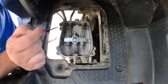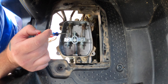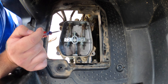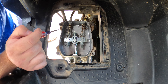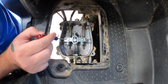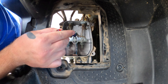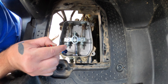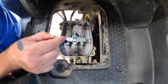That factory setting isn't going to be perfect for every single vehicle. There are all sorts of different options people run — lifts, big tires, different suspension components — which could possibly cause this to be out of alignment even in the perfect factory position. I've seen a lot of people on the forums and on Facebook talk about difficulties getting from turf mode to two-wheel drive. Adjusting this lever — which goes back to the rear differential — will push and pull a small cog out of the differential to lock it into two-wheel drive or unlock it into turf.